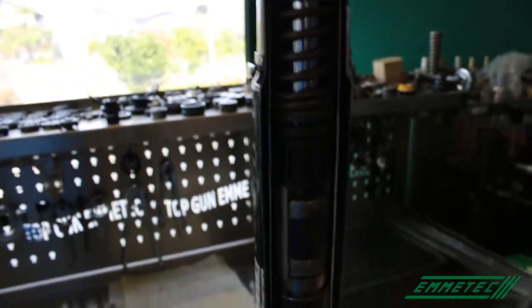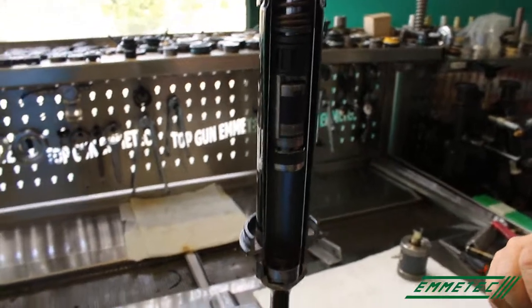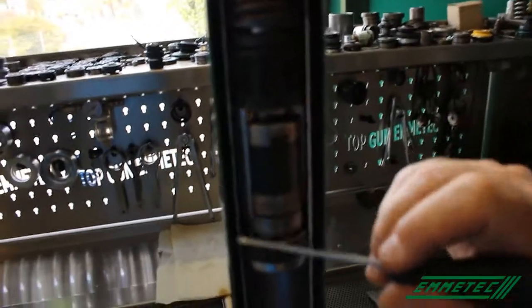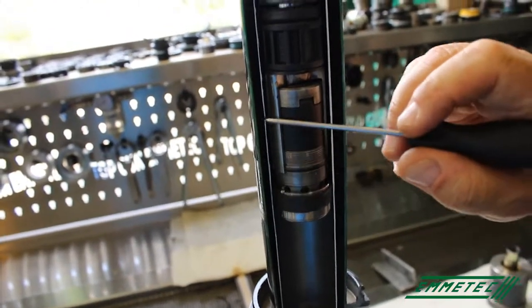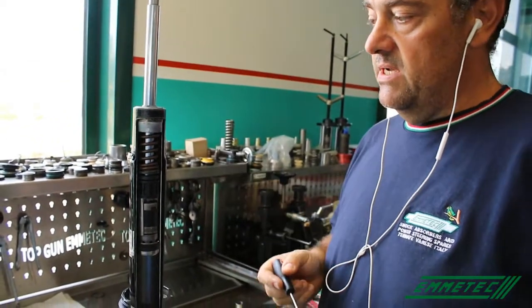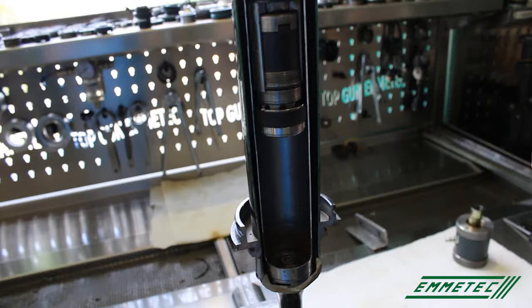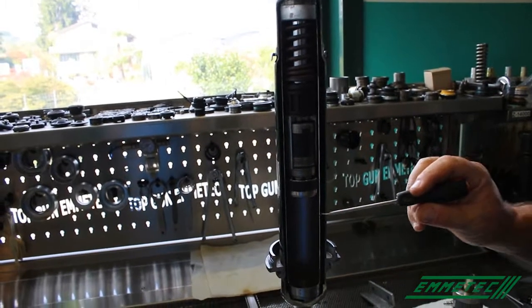One of them is to press the oil in and then into the inner cylinder, avoiding the static oil gap. Then, because of the pressure, it reduces or eliminates or prevents the foaming of air or gas with the oil. If the damping forces are not too high and the gas pressure is high enough, it prevents cavitation, especially in rebound under the piston. Or if there is any cavitation, the bubbles collapse faster.